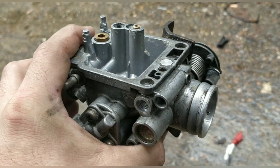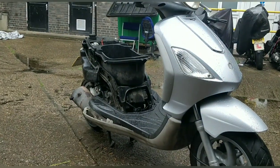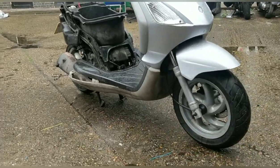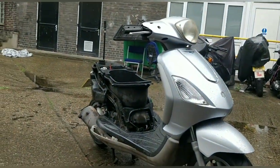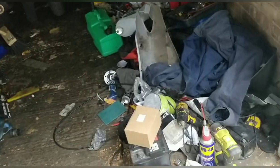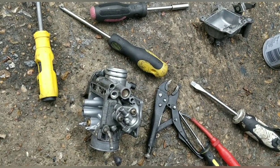This is going to go back on the bike next weekend to see if it resolves the final piece of the puzzle, because that ran wicked with that carb and high flow air filter. The other thing I haven't taken into account is whether the air box happens to be a 50cc one — if someone put it on by mistake. But no, it looks original. All this stuff is worth considering though. So if this carb doesn't run too well next week with the air box on, maybe I'll pop the air box off and give it another shot. Quick clean through and we'll see how we go.